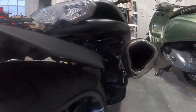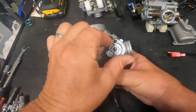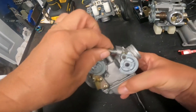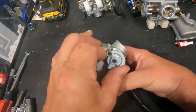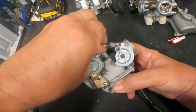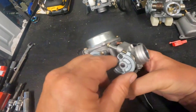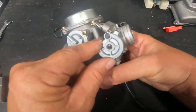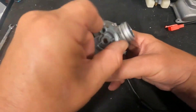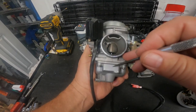This bike did 51 stock and is now doing 56. We can adjust how much air is coming into the carburetor with the throttle cable - more air or less air. The idle is right here. The idle and throttle cable are the exact same shaft, so really that's only one thing. Your idle is controlling how many RPM you want the engine to run at when it's sitting there idling; the throttle is controlling how many RPM you want while you're driving.